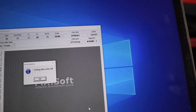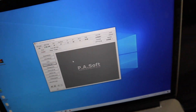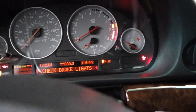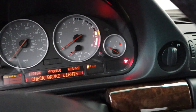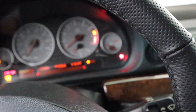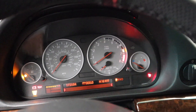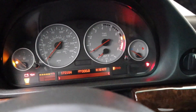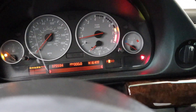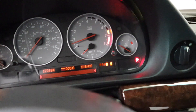It processed and it's going to reset the cluster. It now says 'Coding Data' — hit OK. Go check the car and see if it worked. As you can tell, now I have parking, reverse, neutral, and drive — I don't have those extra indicators at the bottom because it's been converted to Steptronic. I'm going to start the car and test it — reverse works, neutral good, drive under drive.